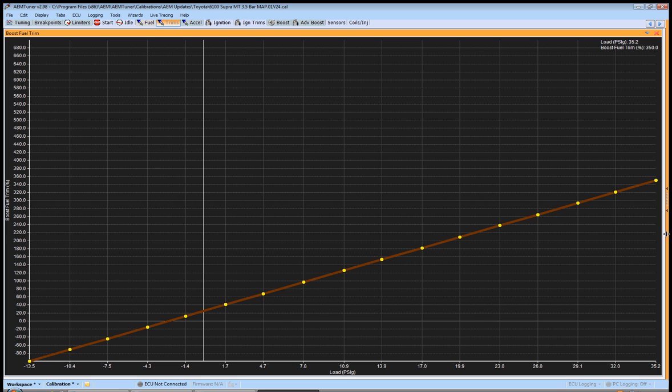Now you have a nice even fuel calculation where it pulls in vacuum. If you want, you can pull this down — set this value to negative 5, set this next value to 5, and then set this one to 20. Select everything to the left of it — hold Shift and left arrow to select — then hit H and it lowers this section so that as soon as you're pulling fuel here and adding fuel here, you're trying to bring this line down to this crossover point right here.